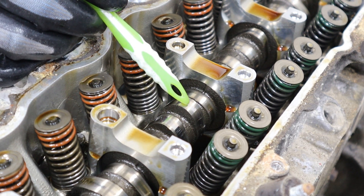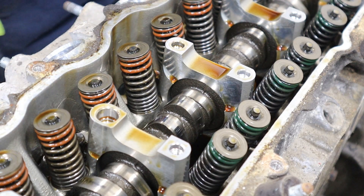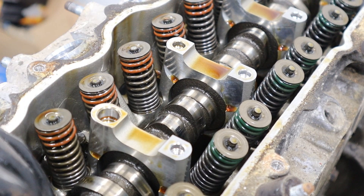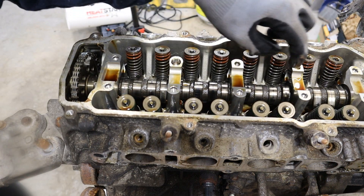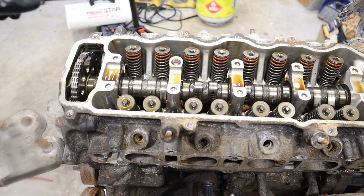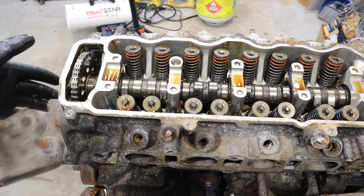This one's lower than the other one, so if you want more air at higher RPM, lock onto the middle one and you're going to get more power. For a more dedicated video on how VTEC itself works, check out my video linked above. Now this is as far as I can get on the top half of the engine, because this camshaft installs into these bearing surfaces as opposed to having cam caps. Therefore I need to take the chain off and slide it out, and to do that I have to take the cover off and deal with that crank bolt.